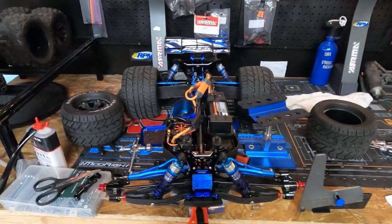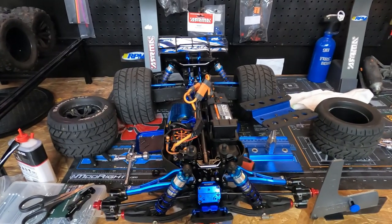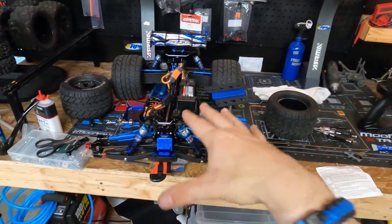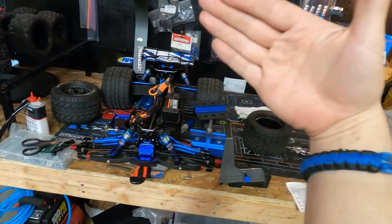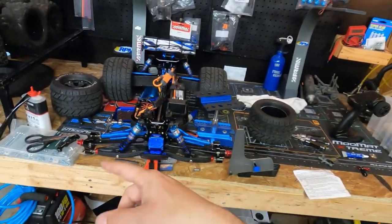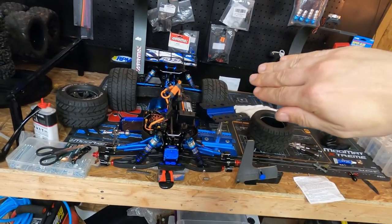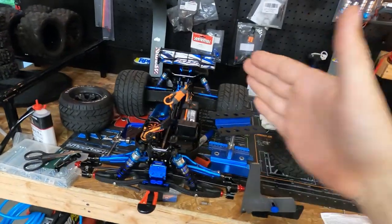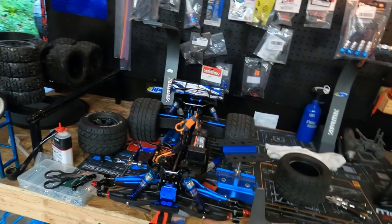Let's say you have a four-wheel drive sedan — you're probably going to want to be right at zero degrees. The best way to know is when you go into a turn: does the back end slide around, or does it stay stiff while your front tires turn but the car keeps going straight? If your tires are turning and the car is still going straight, you're binding the car up and that's not what you want. You want that front end to hit the turn right and those back tires to follow you right through that turn — with a little bit of roll. Too much roll will cause it to come out of the turn wide. You want to enter smoothly and exit smoothly.